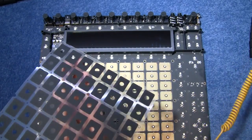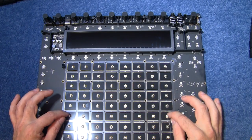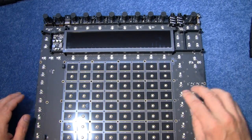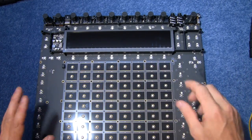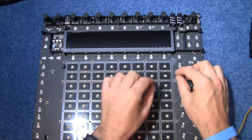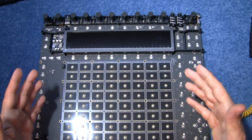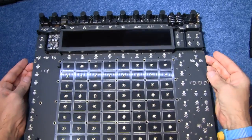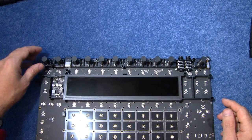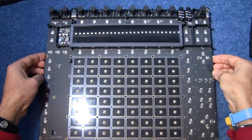I'm going to put that back because if you get one speck of dust underneath there, then you start coming into problems changing values and things. Suddenly before you know it, one pad will only play softly. That sort of problem has come up in the past with some equipment that I've repaired, where I've just had to lift the sheet up and clean underneath and put them back down again because they haven't been as responsive as they were when they were new. I'm not absolutely sure how these touch-sensitive faders work — I can't get this off the board. But very nice.